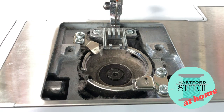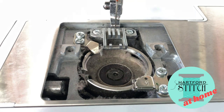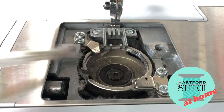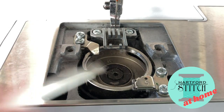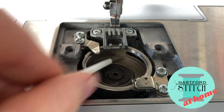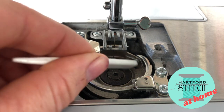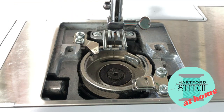If you look in here, this is a mess. Take your brush — or a Q-tip or rolled-up batting if you don't have a brush — and start to clean it out. Look at that big old mess there, and you're going to clean, clean, clean. Then once you think you've gotten it all, turn your hand wheel to rotate the shuttle and work around your needle if it's still in there, and go through and clean out the rest of it.